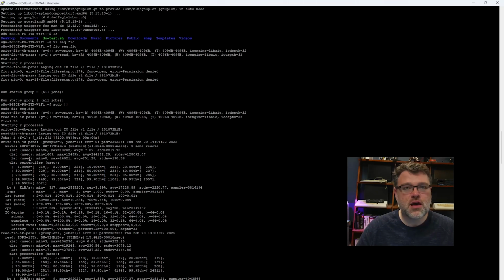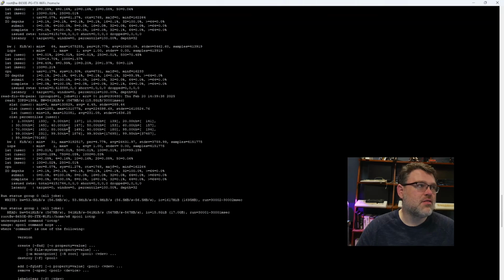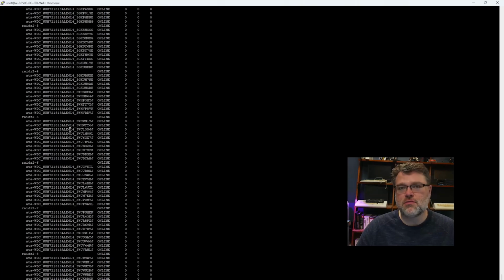Even just doing a couple quick FIO tests without a lot of complexity, things are looking pretty good, but I'm actually going to have to run something a little bit more complicated to test our IOPS and latency and everything else, and that's bench FIO. And that's something I want to get into in another video, but I'm also curious about what disk configurations you want to see. I want to test this 9 VDEV wide RAID Z2 configuration,